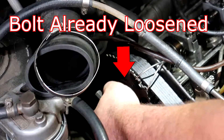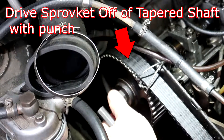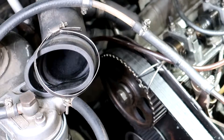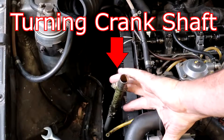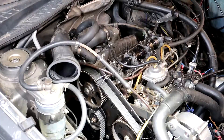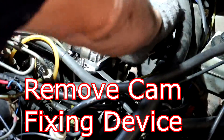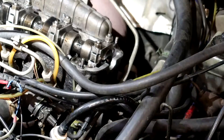It's a couple of degrees off. I'm not really sure how much that's going to affect our fuel economy. Setting the valve timing is the timing of the camshaft in relation to the crankshaft. We loosen this bolt, take it loose a little bit, punch into the little hole and knock it loose, then tighten it back down so it's just snug but will still turn on the camshaft. Then we bring the timing mark around on the flywheel so they line up. The camshaft is set into position and we torque the bolt back down — 33 foot-pounds. Not rocket science. We'll pull these tools out and we're done with those for now.